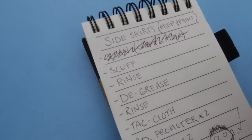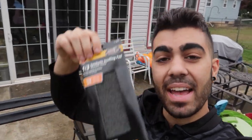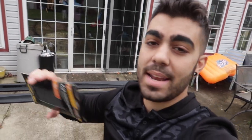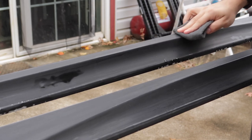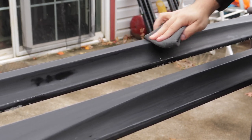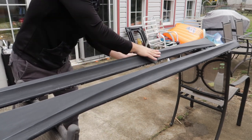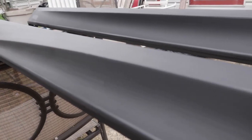The next step we need to take is to scuff the side skirts. To do the actual scuffing, I have a gray scuff pad, ultra fine scuff pad. I picked it up at Pep Boys. You can get it at AutoZone or O'Reilly's. From what I've read, if you have brand new plastic, do not sand it. Don't use sandpaper. Use one of these scuff pads, ultra fine. This will get the job done. The side skirts are scuffed. These things are ready to go. Nice and smooth, no edges.